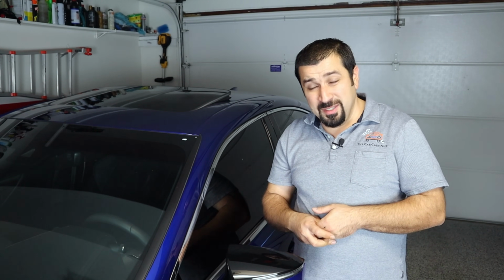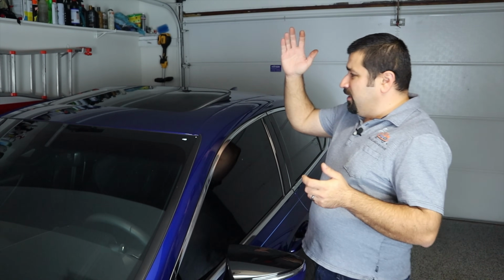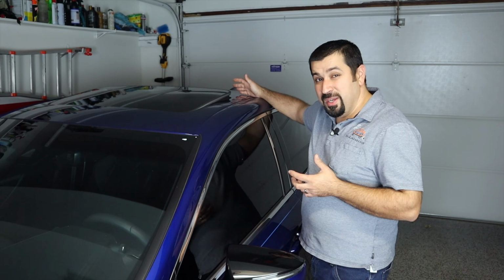And actually, I recommend you do it every year. When the fall is over, clean them. And when you're going into fall, so you only have that small window that you need to take this procedure, do it before fall, so you're ready for fall in case debris falls in, and then after fall is over, so you make sure you go into winter with them clear. Now, one thing I will say, the drains, the fronts are the ones that always get clogged. Very, very rarely will I see a car with the rear drains clogged.